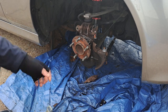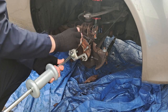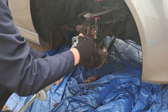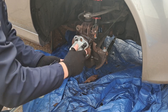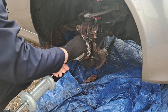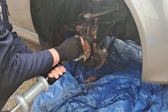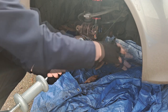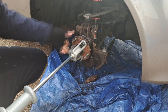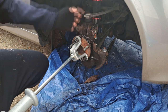I'm on the other side of the car because I've got more space to show how this goes. That's how your hub puller will go on. I use my normal lug nuts — these are in terrible condition, I bought nice black ones to go with my wheels but didn't realize they were steel and they just rust. Anyway we'll get some new ones at some point. Basically what's happening is, because this is bolted from behind with four bolts, we're trying to separate this part and pull it out of the upright.